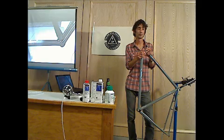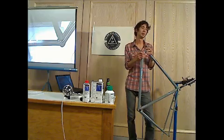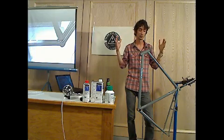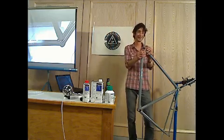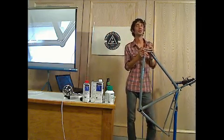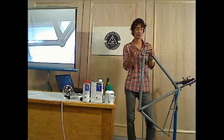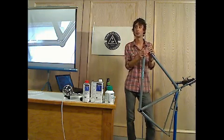Are there tricks to do it? I mean, the main thing is just a cleanliness issue. The reason people do it in booths, and the reason I do it in booths, is that you're keeping that little box as your sanctuary, and it really is a sanctuary because of everything else out there. Explosion proof sanctuary. But yeah, the main thing you'd run into is dust, because dust is the enemy of paint, and you would see that if you were painting in a garage.